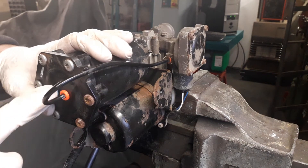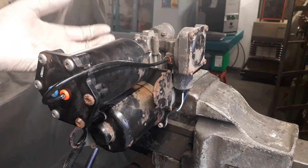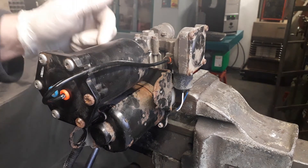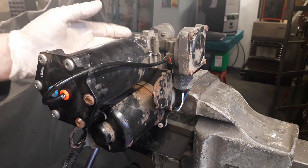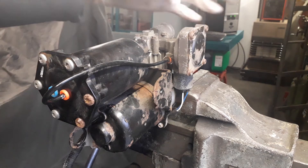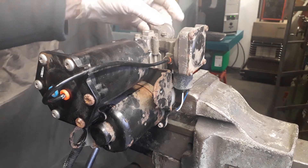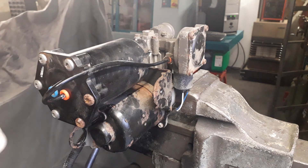You have an air dryer cover that can leak causing a C1A20. You have a filtration kit that's blocked and condensated, which can also cause a C1A20 or a leaking joint. There's a delivery valve — a one-way valve underneath this nut — that can allow air pressure backtrack and reduce outgoing pressure. Worn piston seals won't provide correct pressure. The exhaust valve can be stuck open letting all pressure out of the compressor. The intake pipe entering the cylinder head can also be blocked or restricted.